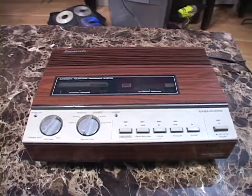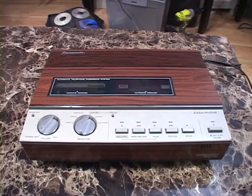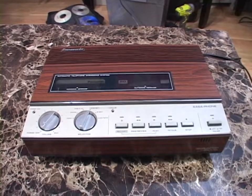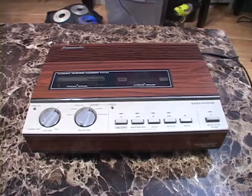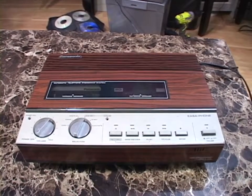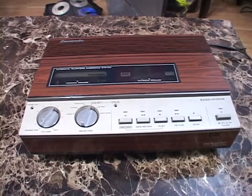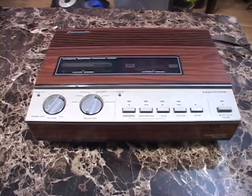The concession you make with an answering machine that uses a single cassette is that, at least in the case of most of them, the outgoing message and the incoming messages are stored on the one cassette. Your outgoing message is recorded at the beginning, and then incoming messages are recorded after it. That's usually fine, but if you get a lot of messages — say you're away for a few days — the machine has to fast forward through all existing incoming messages, and your caller has to sit there and wait for the beep. In this day and age, they're probably just going to hang up.